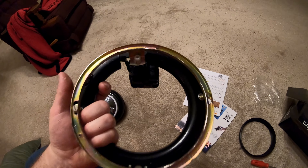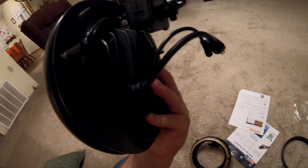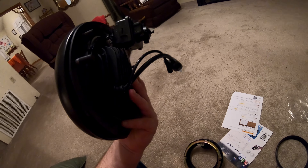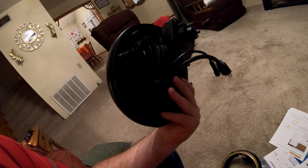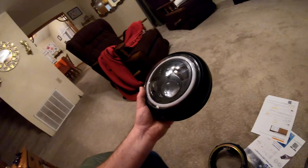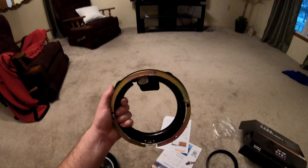I have a before and after. This is before I put the actual light in — I've already done the trimming — but this is what it looks like when it's all said and done. One tip: if you try to do this yourself, you will tear these gaskets on the back if you're not careful, because you'll be taking them off and they'll get hung up on these little bolts sticking out the back. The material isn't as tough as you think it is — mine's still in one piece, just kind of mangled.